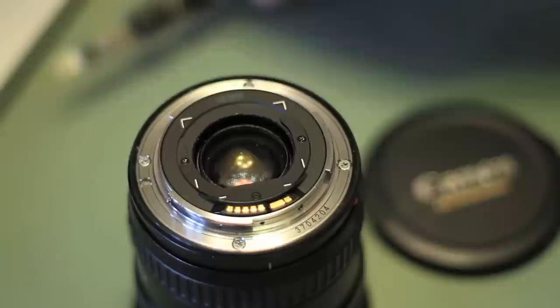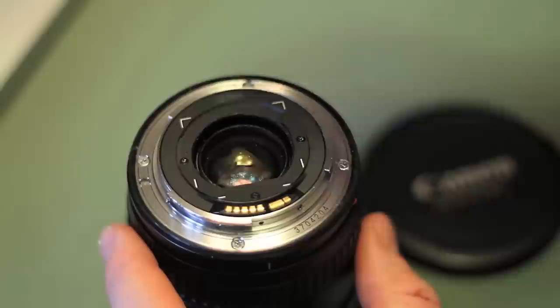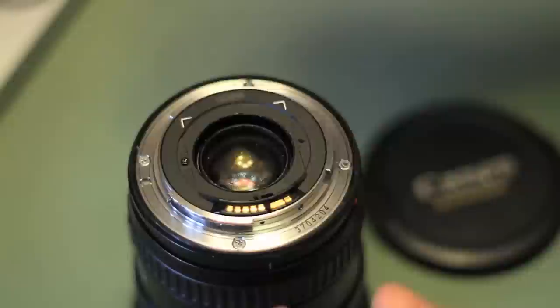So here's the steps I took. At the back of the lens mount, you have these three screws holding this little plastic U-shaped tab on. Those are the first things that you take off. My tab broke on one side when I took it off the first time because I have a stripped screw, but I'm not too worried because the piece will still be able to stay on.